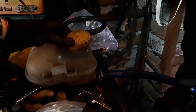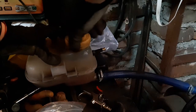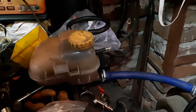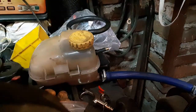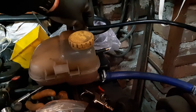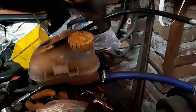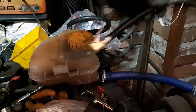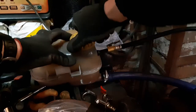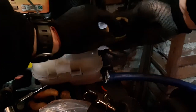Disconnect one of the pipes and block it with a little piece of pipe, like I did — with a bolt or something. Or if you have a spare coolant tank you can make one as well, but I doubt you have a spare. I just replaced mine and have this one left, so I made it just to test caps. Then you need a piece of pipe on this side, but since I had a connector here I just drilled the opening and put in a tire valve.